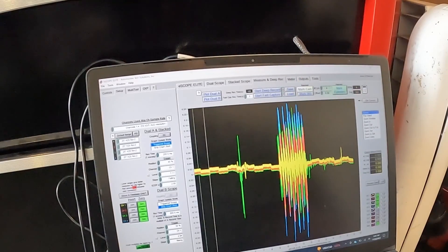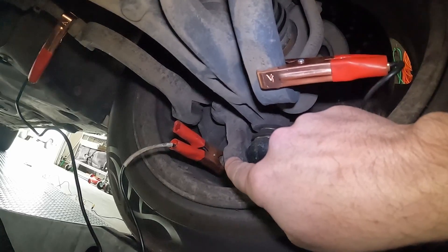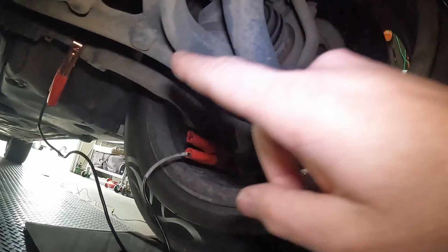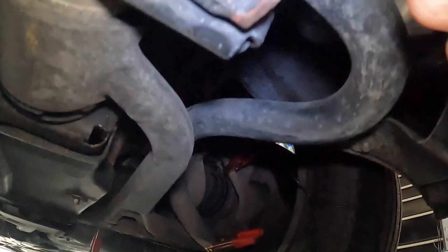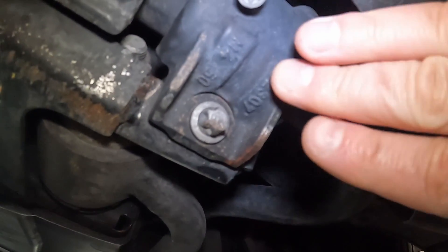Let's go find our white and see what it's hooked up to. Right here is our white connected to our lower ball joint — that was our loudest. There's a little noise coming from our tie rod and a little noise coming from our sway bar link. The least was coming from our sway bar. So right here, our sway bar bushings — those tend to squeak when they dry out — we can rule that out because our sway bar isn't making much noise.